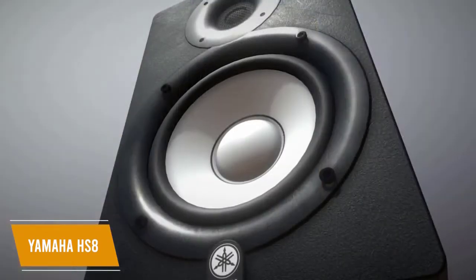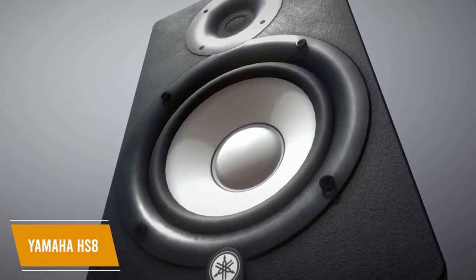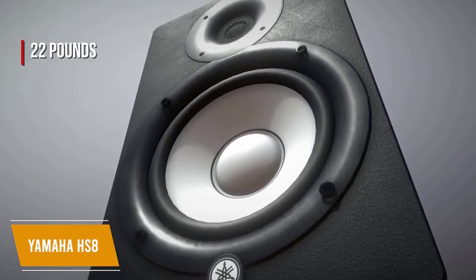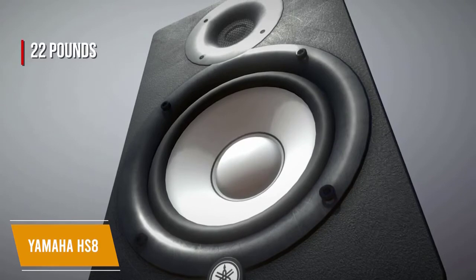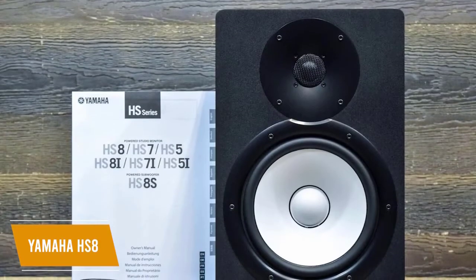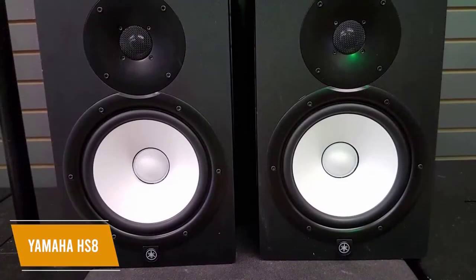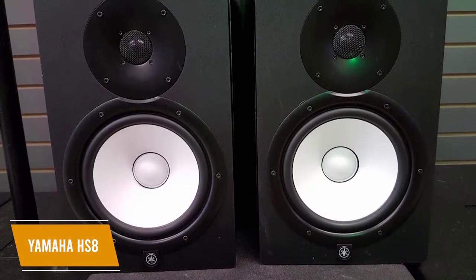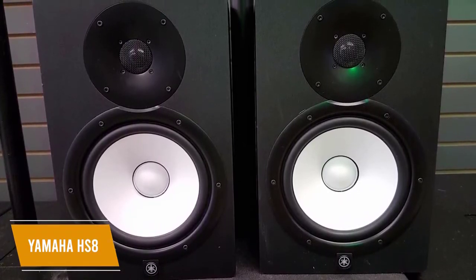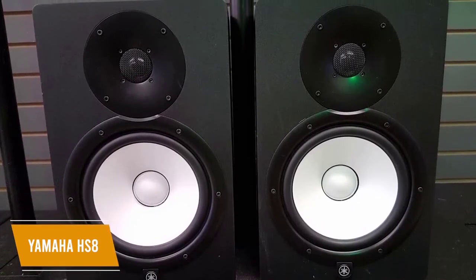The enclosure is made from a durable MDF board and a three-way mitered joint that improves sound by reducing resonance. Unfortunately, it's relatively large and weighs 22 pounds, so it might be too heavy for some shelves, but you can get a mountable version for a bit more to free up desk real estate. It connects through TRS and XLR ports. The Yamaha HS8 offers top-notch performance, a large driver, a bi-amp design which is a rarity at this price, and useful room-tuning options — recommended for producers looking for a powerful monitor.